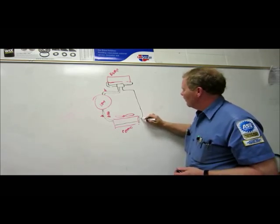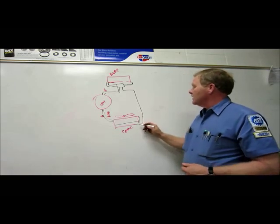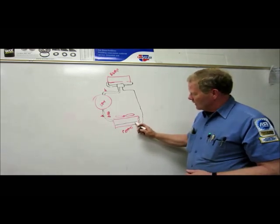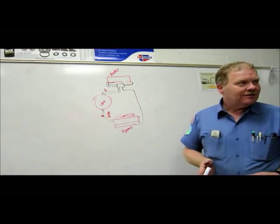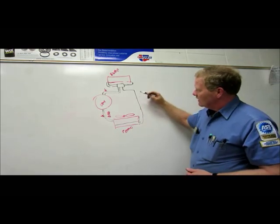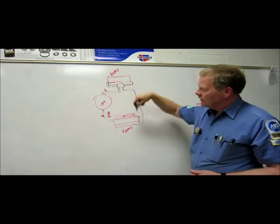Okay, and this is coming off down here. All right, so what happens is, this comes in here, condenses, turns into a liquid, and then it goes through here, then it goes into this lower part, and this liquid that it has turned into gets cooled. And then as the liquid gets cooled, it's basically cooler to begin with when it's going over here. But it's also going through this expansion valve. And then this makes you cold, so it's still doing a circle.